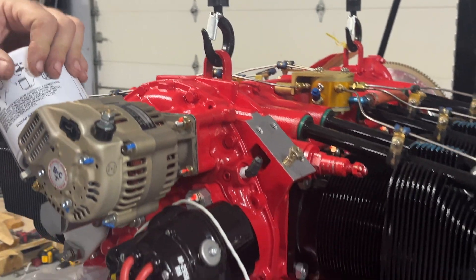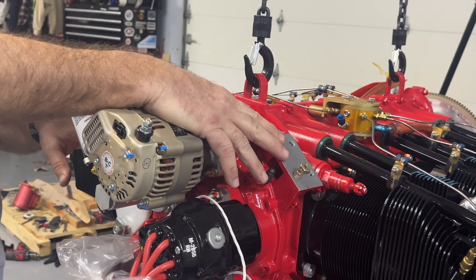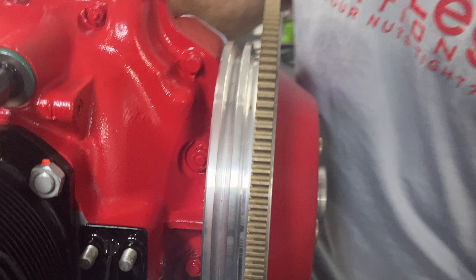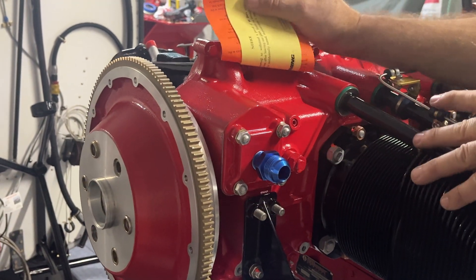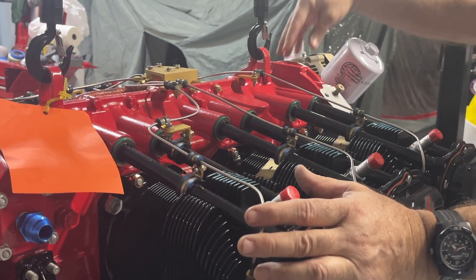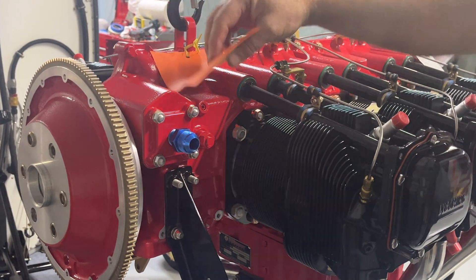You can see down here the engine mounts have been mounted. These are the bottom lower engine mounts — we're not using the typical top ones you'd see on a Dynafocal mount. Since this one sits at an angle, if you come around to the front you can see the forward engine mounts are right there, and there's one on this side as well. Right above the forward engine mount is the engine breather line. We can't use the typical breather line in the back because of the way this sits — the accessory case will be pretty much full of oil. So that one is plugged and we're picking up a breather on the front where normally a front-mounted governor pad would be on an IO-540.